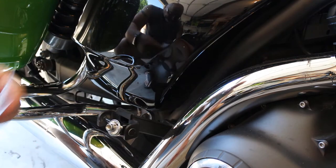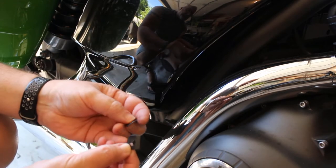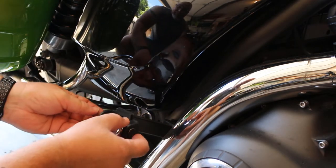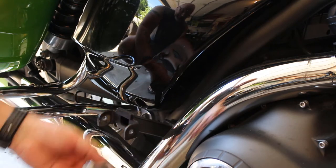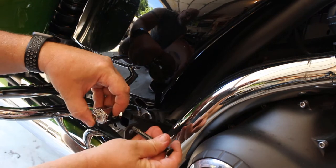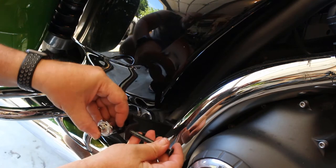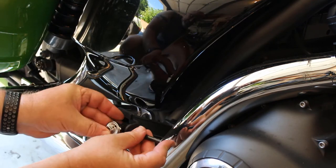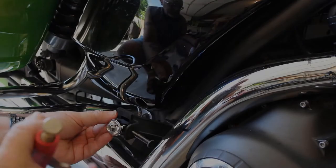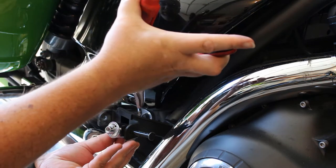Next I'm going to install the one and a half inch spacer I bought from the hardware store. This is the only moderately tricky part of the whole installation. I found that having two of the d-shaped spring washers which came with the spline adapter were perfect when placed in combination with this one and a half inch spacer, but getting it installed was tricky. I used some vice grips to help me compress the first spring washer — it can be a little tough to get the spacer in position, but it does work well.